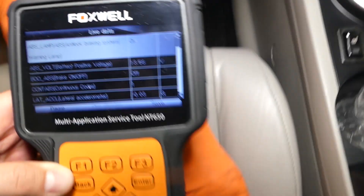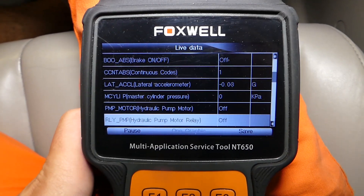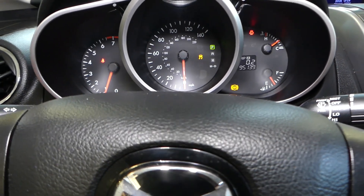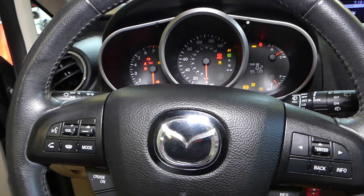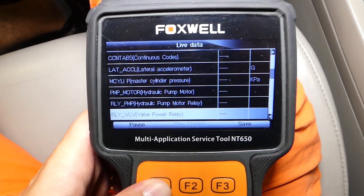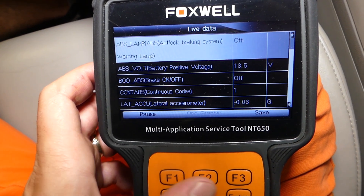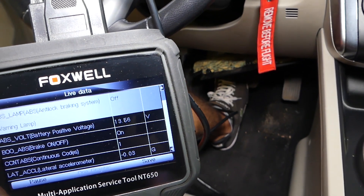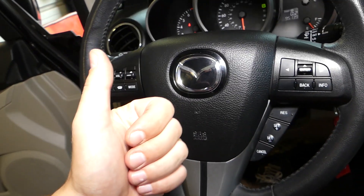Brake just stays off — it doesn't change at all, as you can see. You can also see all the different traction controls and things like that. What I'm going to do now is go ahead and quickly replace the brake light switch and see if that will fix the problem. You can see how our ABS and traction control light is on — that's normal. I went ahead and replaced it. It says no communication here because we had the ignition off. Let's see if it's going to reconnect — yes, it did connect. I'll go ahead and press the brake pedal one more time. Check what's going to happen now — it says 'on.' So that's a good working switch now. We had a bad brake light switch. Hopefully the video will be helpful. Thank you for watching. Please subscribe to the channel for more videos, and see you guys next time.